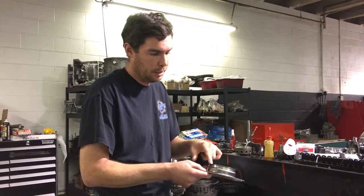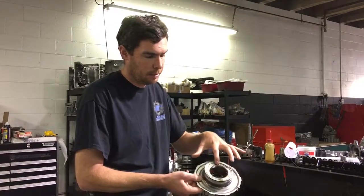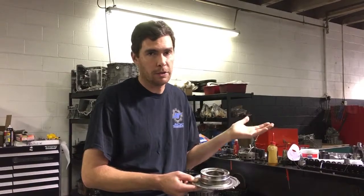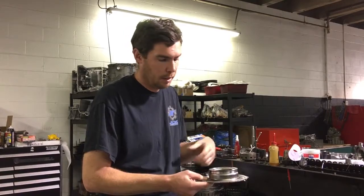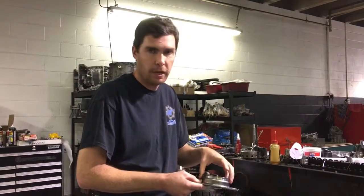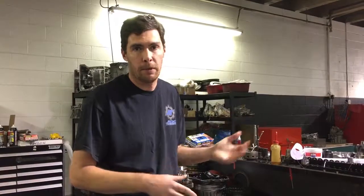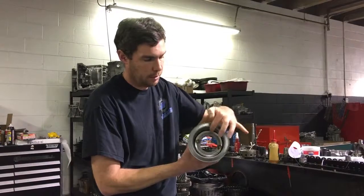Well, this technology here uses a sleeve that we press onto the factory piston assembly, tack welded in place, and the seal that we use is the industry standard for transmission oil seals. This is a carbon impregnated PTFE seal, which you'd find in many standard automatic transmissions out there. So it's a very reliable seal. It's designed for a lot of pressure, and it's designed to last the life of the transmission at 20 bar plus without a problem. We also make one for the B seal as well.